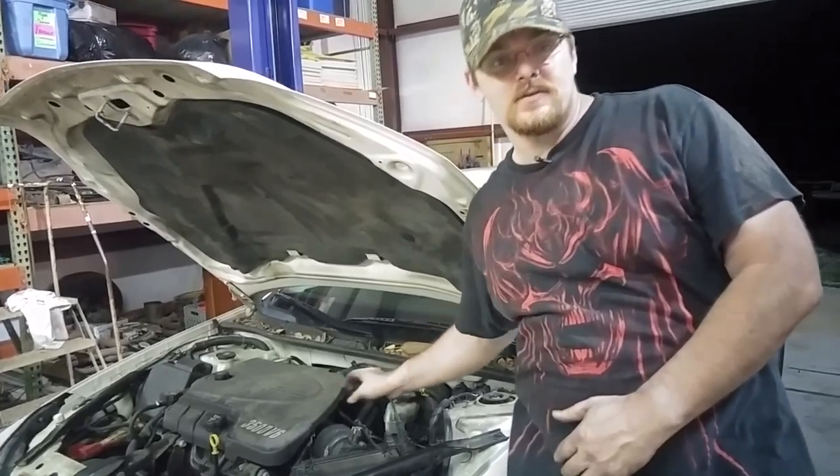All right. So we got all four done. Didn't record them all because, like I said, it's pretty much the same for all four. When you're done, don't forget, pump your brakes about a dozen times. Check your fluid, make sure you top off your brake fluid, and then take it out in the yard or the driveway and test it out, make sure your brakes work. And that's it. Simple job, doesn't take that long. The more you do it, the quicker you get at it. I know people that can do their brakes in an hour.